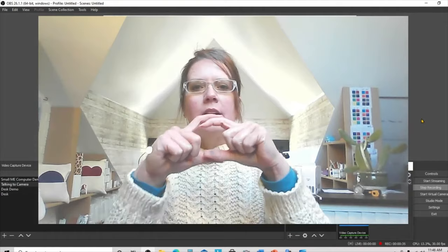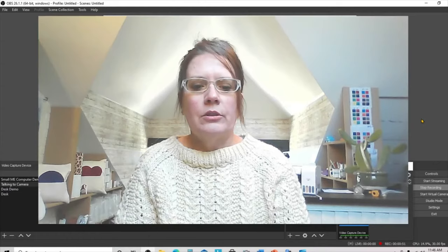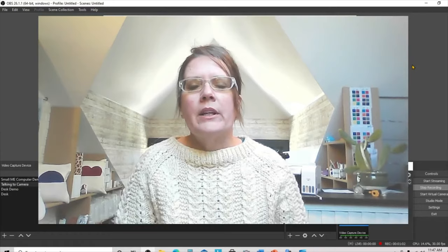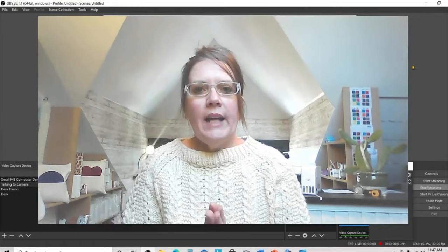You also have all of those same options inside of your Epson printer on that little square LCD screen - you can click over to settings. That is the second place where you have the exact same settings. When something doesn't match, for instance you tell your computer to print on legal size paper but the Epson is set up to print on letter size paper, that is when you will get that error. You can press and override it, which is probably what you're doing - just pressing continue printing anyway.